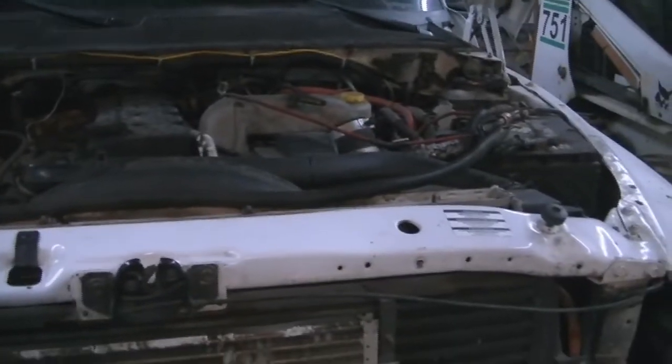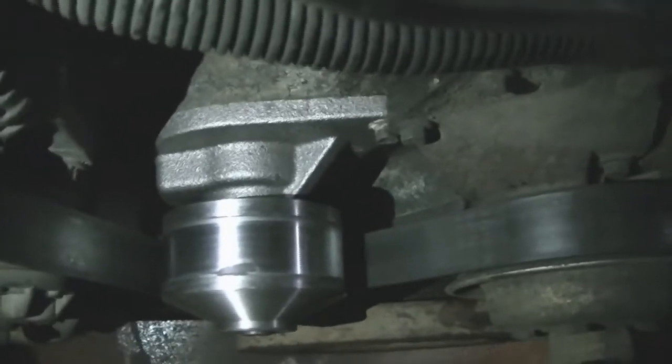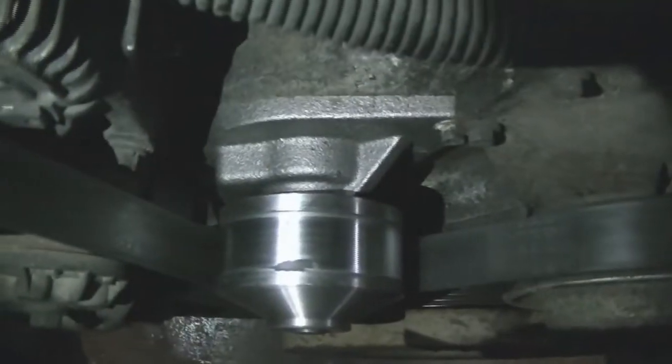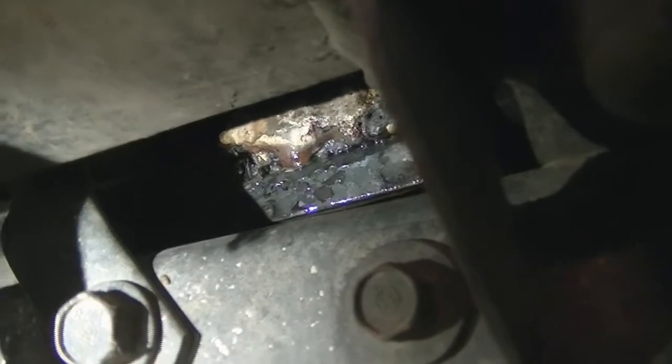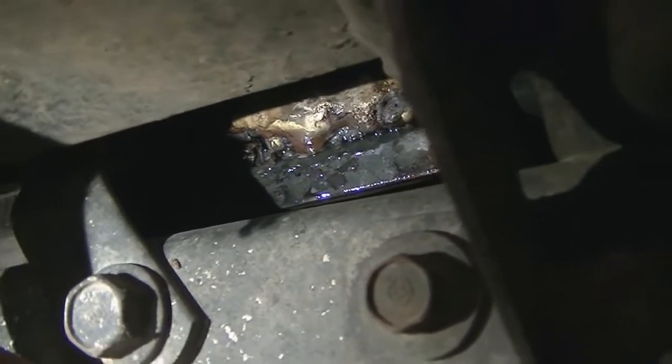I am not having a good day. Started off with just a water pump which I changed — the old one wasn't really that bad but I changed it out anyway. Then I was chasing down leaks and had a big leak on the radiator. Let's see if I can get a good shot of it — yeah it is leaking like a sieve. I tried to solder it and that didn't work.